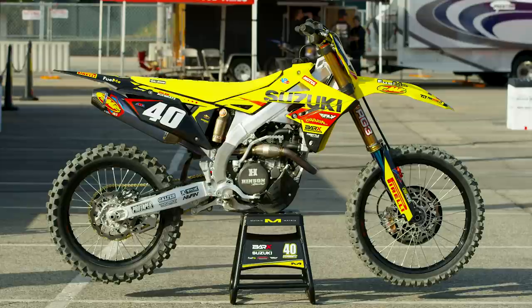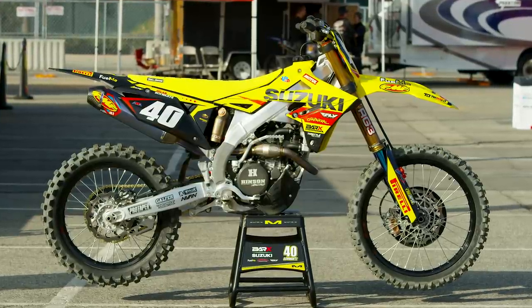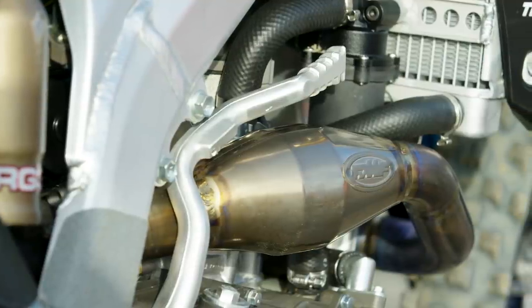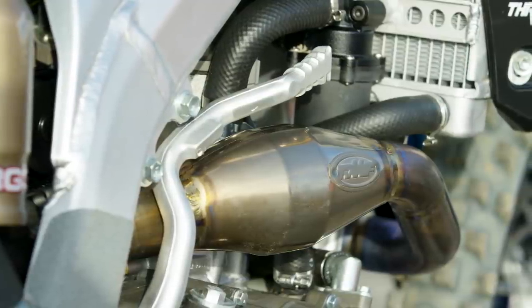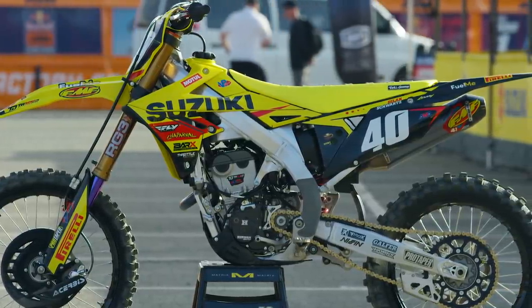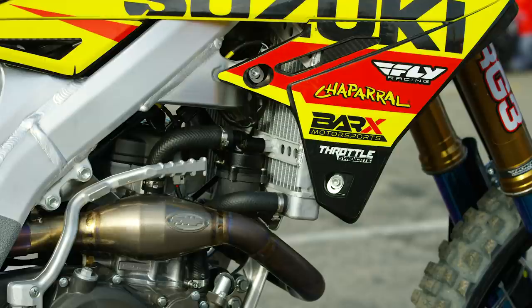Nothing on this engine is left untouched — the transmission, crank, rod, piston, cylinder head, and all the valve train. The head is ported based on the best spec they found when they took the JGR motor apart. The piston is designed to Jamie Ellis's spec by JE Pistons, and it's highly likely the rod is a Wiseco Racer Elite, as Wiseco and JE are owned by the same company, Race Winning Brands. The bike very probably has a long rod kit — that does not mean it is a stroker. The piston still travels the same distance as stock; the rod itself is longer, meaning the crank pin has been repositioned or the piston pin moved up into the piston farther, giving a longer rod which changes dwell time at top dead center, which can increase power and alter engine character.